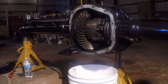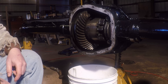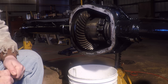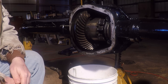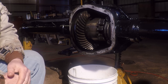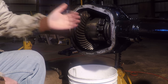Hey guys, JC Smith here. Today we're going to work on this differential for Brandon. It's a Ford Sterling ten-and-a-half inch ring gear. The pinion seal is out of it — it's leaking. We've already got the cover off. I want to look at the pattern on the gears to see how they were wearing, and look at the bearings on the carrier, so we'll go ahead and get at it.